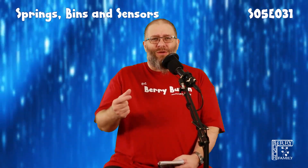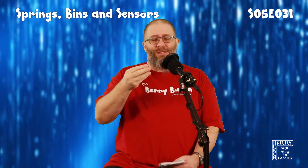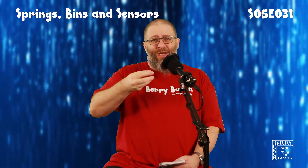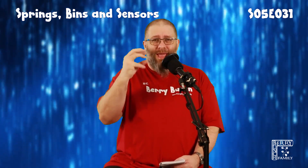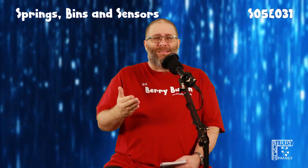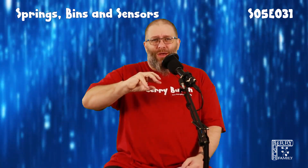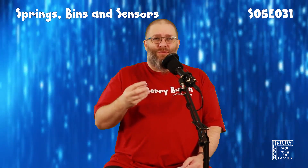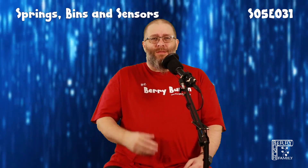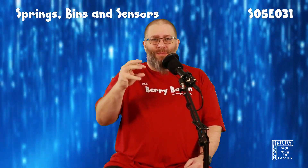Inside there's a rod that's attached to a motor. When the motor turns, the rod changes position. As it changes, it's sitting inside of something else which then forces the bin to open. They're both made of plastic, which is a really stupid engineering decision, because when you get something that's plastic and you put it under immense tension and it's quite thin, it's going to break. And that's what happened with ours — the bin was not able to open because the motor was still good, but the bit that the motor was turning was no good at all.